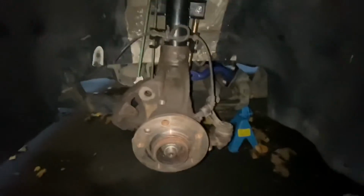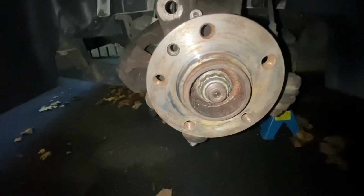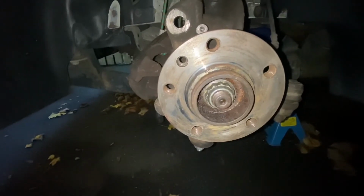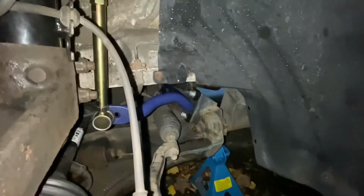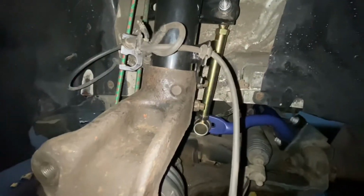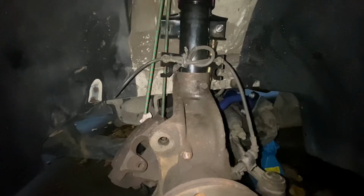Right, so just bolting it all back together now. This is a bit where we're going to torque everything up with our torque bar. I'm going to get it on with the impact wrench first, then torque it up. The drive shaft retaining nut is probably the largest amount of torque we need to apply to any of these bolts. I'll put a sheet on here on the next slide just to show you the order that I'm going to do them in. But just to go through it, I'm going to do the ball joints first, then the anti-roll bar clamp, then the anti-roll bar drop link itself, then these bolts on the back of the leg, and then I'm going to put the caliper back together, and the disc back on, the plate back on the disc, etc. And we should be good to then go up top and talk about those top mount bolts.